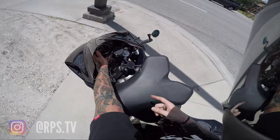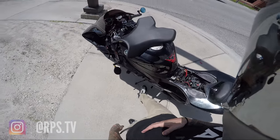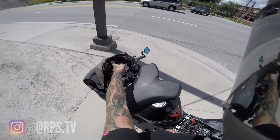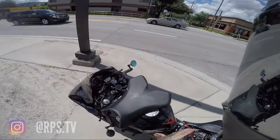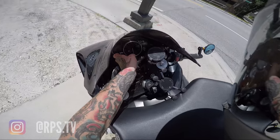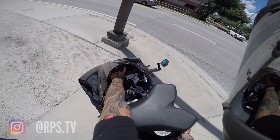Going back through here, D21 is 'off' for me — that's my neutral switch or kickstand kill switch. So even with my kickstand down and in neutral, it doesn't know it's in neutral because mine is broken. I can't start the bike with the kickstand down ever — I have to pick up the bike and turn it on, which is really annoying. I'm gonna fix that sooner or later.